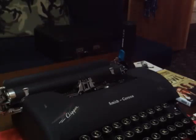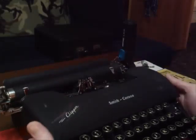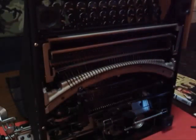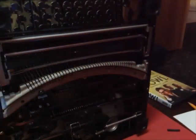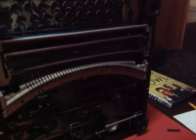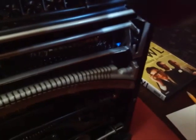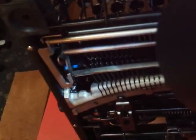On the Smith Corona Clipper, the problem I had after cleaning her up was underneath with the old rubber parts. They rebranded the standard — the old flat top glossy thing. That was the complaint about the piano style: the glare. So they went to this wrinkle finish. It's basically just the standard inside. But if you can see where I put the blue, that's shrink tubing — heat shrink tubing — there and there. That was just a black little piece of rubber hose. Its whole job is to hold that spring on each side from walking. It serves no other purpose.